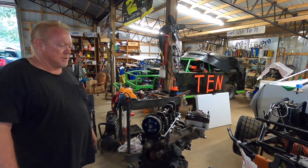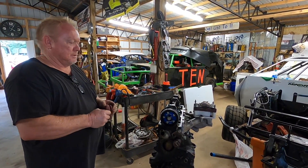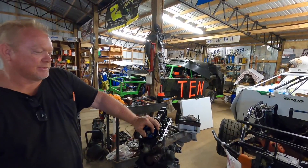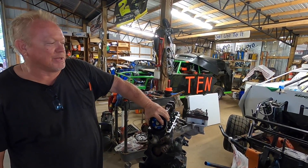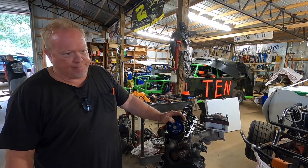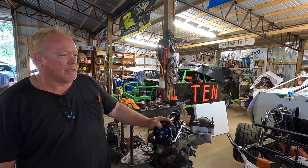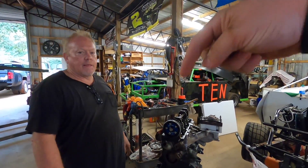If you're on a 2.5 you've got to weigh 2,500. With the 2.3 you've got to weigh 2,300 — it's a weight break for the smaller motor. We used to run 2.5s and loved them — won a lot of races — but now the 2.3s are the way to go. Back then we were turning motors 7,400 RPMs and probably won 100 races in a 2.5. But nowadays they're turning these engines 9,100, 9,200 — some of them more. We don't like to turn ours no more than 9,100. A 2.5 motor, we just haven't got one that'll do that, plus the weight hurts you.